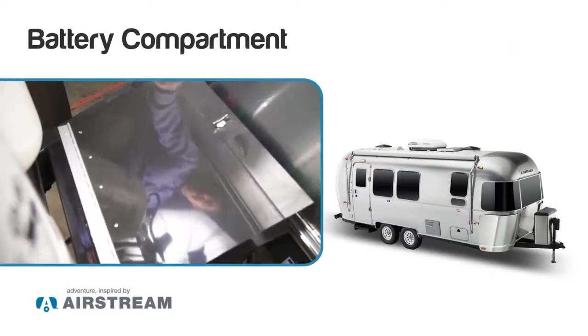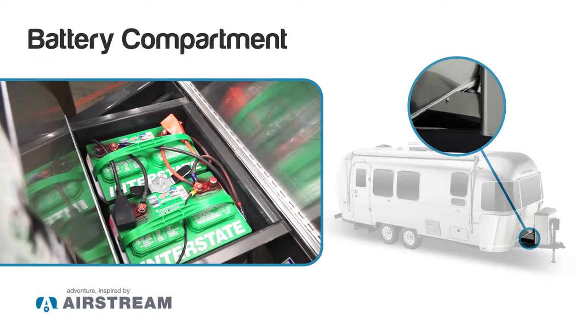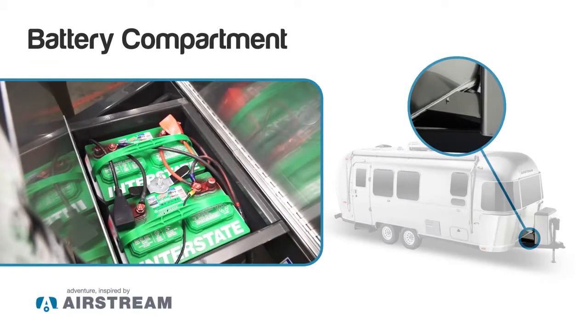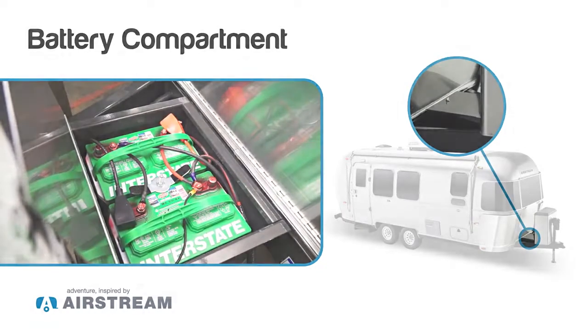Next, just want to show you the battery compartment where the batteries are. This is the power supply that you're going to need for all your lights in the interior of your trailer if you're not plugged into 110. This will run everything but your microwave and air conditioner. There's even an inverter in this trailer that will take power from the batteries to run some 110 appliances. These batteries are also charged from the charge line from your tow vehicle through the 7-way cord.